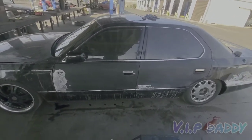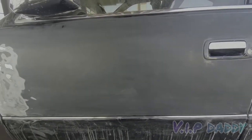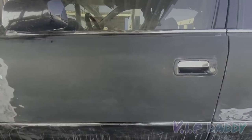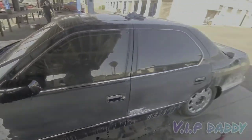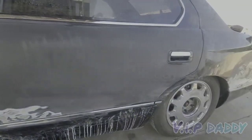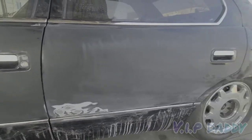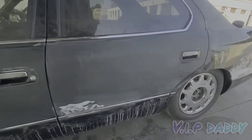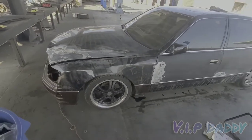If you can remember what it looked like before — that's what I was talking about by getting the spots out. I really don't have to go too in-depth because I'm probably going to leave the car black, and since it's already black I don't have to cover much. But if you were doing a color change, you'd want this completely even. I'm just knocking it down to get it even where I sanded, because I'm going to build it up with primer — filler primer — and go from there. This is a long process, so don't try to rush through it. You rush through it, it ends up crappy.